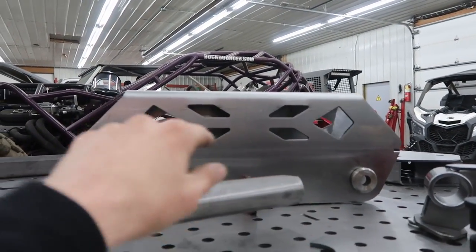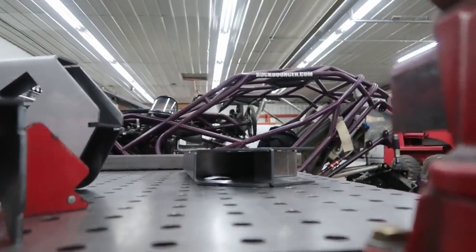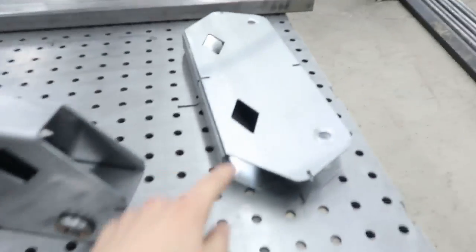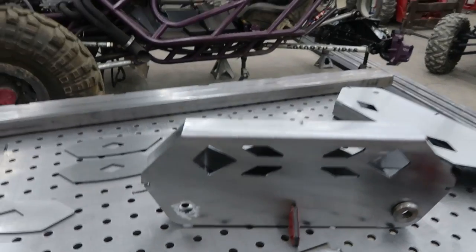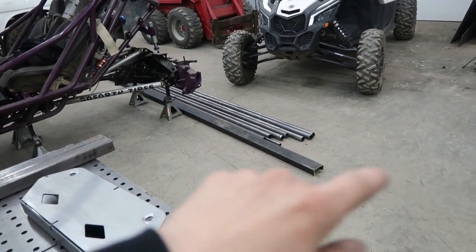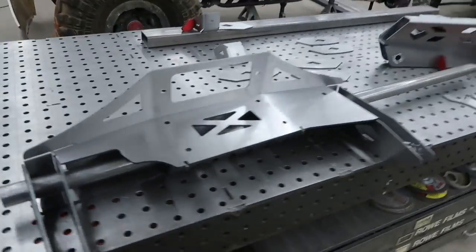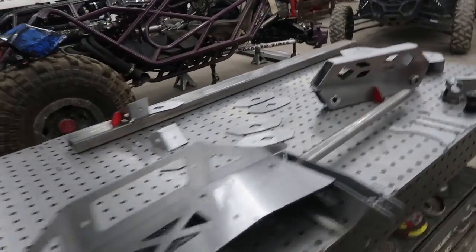I have 140 feet of tube for the whole rest of the back half. This is going to be the sub-frame — my lower link mounts. We're doing four-link and three-link front. The two-by-three frame will go in and hit that back stop on both sides and get welded all the way around. We have everything designed in for the LS motor mounts, upper link mounts for four-link and three-link, and it'll be basically a full custom frame — everything will be all custom on this thing.